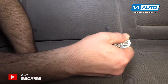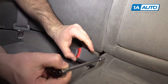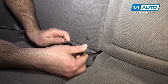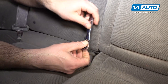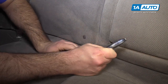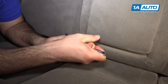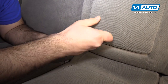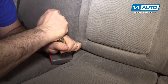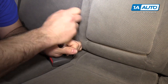There's a 10mm bolt hidden behind the seat cushion. You can go in between where the buckles are, find it, and remove the bolt. The bolt goes through the body and probably sticks out towards the bottom of the car, so it's a little bit rusty — believe it or not, even though it's an interior bolt — but it is coming free. There we go.